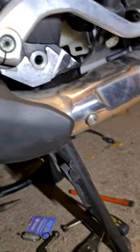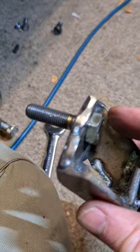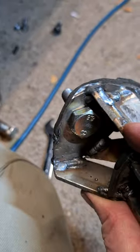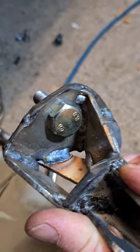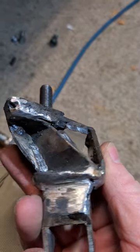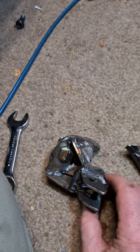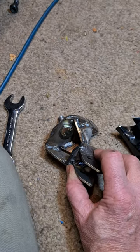It's very heavy compared to the aluminium counterpart, but it bolts straight on. I flattened that face off — it doesn't rotate because I've welded a step into it in the right place. I've tried to replicate as much as I can the different components, make it strong enough that it doesn't flex, because it did flex as one piece. I'm only 12 stone — not showing off. It obviously can't be stronger than the bike, otherwise the frame will start to bend and pull apart.